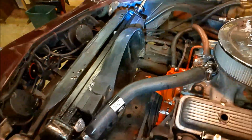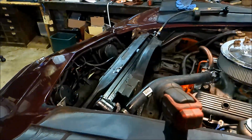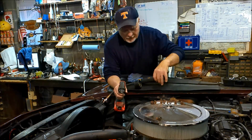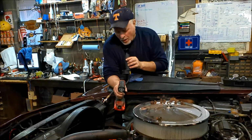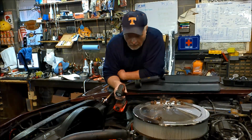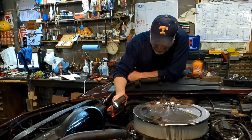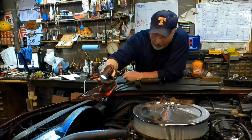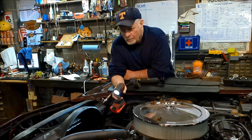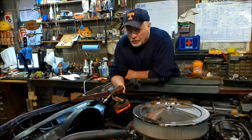So definitely three leaks. You know, the radiator shop said they pressure tested it. Be right back. What was I saying? Oh, the radiator shop. Let's see. I put it up to 10 PSI. It's down to, looks like about 7. So it's dropping. Radiator shop said it pressure tested it. And I'm looking at that place right there. There's no way I could have damaged that or that up top. It's possible I did this one, putting it in. But those two I didn't. So I'm going to kind of question whether or not they did actually pressure test it, even though it looks good when you look down the core.